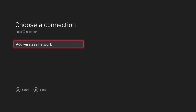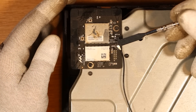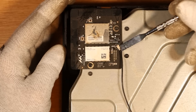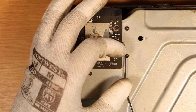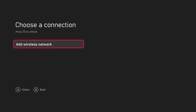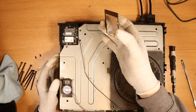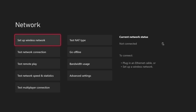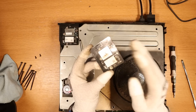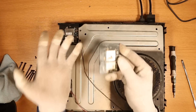I don't actually think the wireless is working on this console. I'm pressing X and it's not allowing me to set up a wireless network — it just gives me the choice to enter an SSID. I'm going to take it apart and have a look at the Wi-Fi card. The connector isn't actually attached fully — it's only attached a little bit. I'll disconnect it, the center looks fine, so I'll put it back down and see if it was just a little bit loose. That hasn't worked — still coming up saying add wireless network. I've swapped out the Wi-Fi card. Turns out it was the card itself.